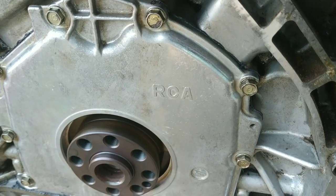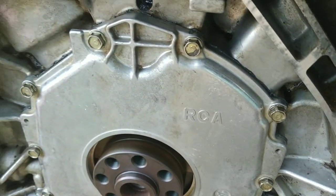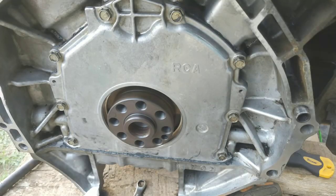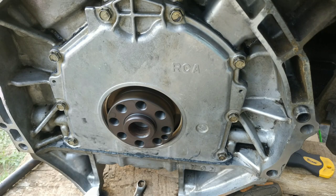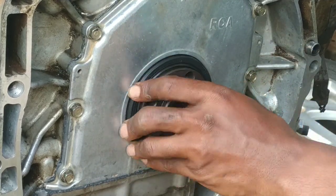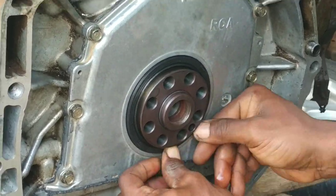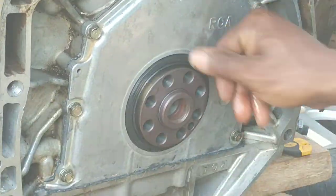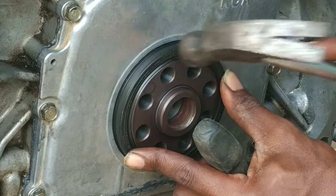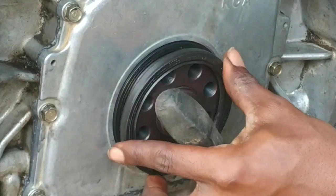While I wait for an hour to elapse, I'll move on to the other end and start working there. After about an hour, using a torque wrench, I tightened the 10mm bolts to a torque spec of about nine foot-pounds. Now onto the installation of the rear main seal itself — I applied some engine oil to the inner lip of the seal, then pushed it on as far as I could using my fingers, and then using the old rear main seal, I gently tapped it into place, being careful not to hit on the crankshaft.